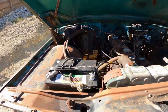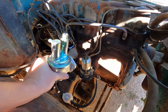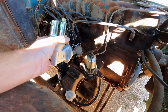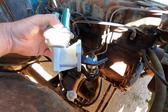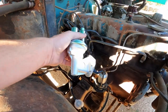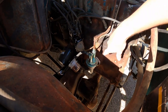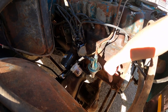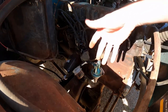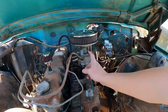Let me see if what I got is the same thing. Okay, what I got is completely wrong. But I'm going to go ahead and take this fuel pump out and look at the arm, and if the arm is the same I'm going to try to use this one. Alright, so I got the new fuel pump installed, lines tight, got it torqued, got the arm on top of the cam where it's supposed to be. Let's see if we can get this thing to start and run normal, and if it dies we'll see if we have any fuel here.